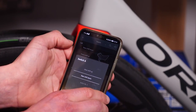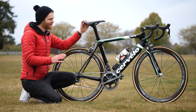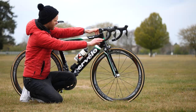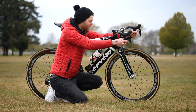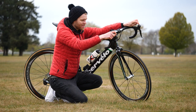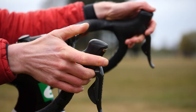One of my favorite features is that Di2 has opened up the possibility to have additional shifters on your bike. Casting our minds back to STI shifters — that was such a massive game changer, moving shifters from the down tube up to where your hands were. Now we can have sprint shifters on the hoods so sprinters can change gear when they're down there, but also climbing shifters — riders like Chris Froome love having climbing shifters on the tops. Even little hidden buttons on top of the shifters can be used to change gear so that if you're riding in an aero hoods position, you can change gear just with your thumbs on top of the hood.